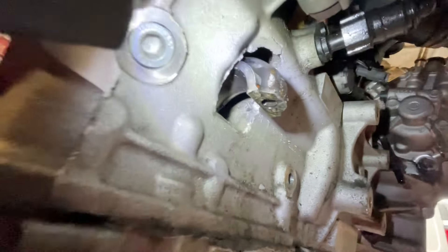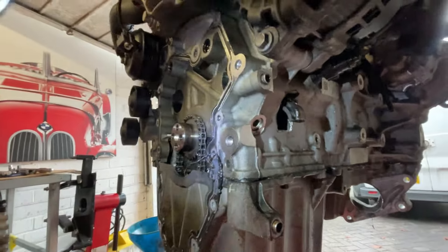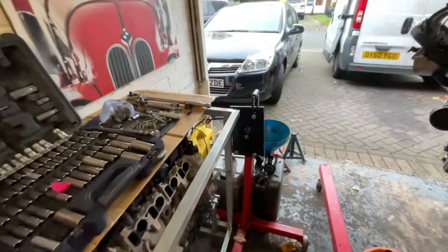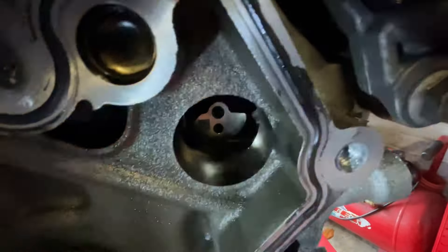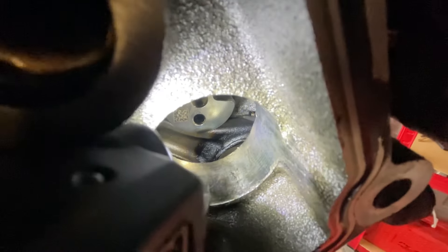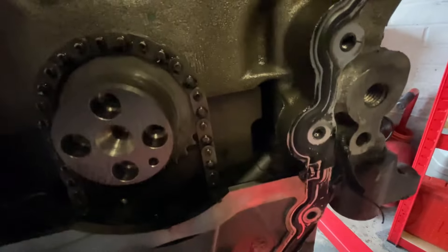So that's what's gone wrong - this engine has let go. The cap's come off. I need to speak to the owner of this engine and see what they want to do. Looking inside, I did find a bit of the camshaft as well, which has failed - probably when the rod came through. You can see the rod in there and it's just smashed the shaft. Looking at the rod, you can see it's got very hot - there's blackness on the rod due to overheating. That rod started to seize up, it's been knocking, and then it let go.